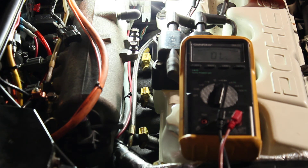I'm pretty sure Megasquirt had nothing to do with this, so I'm going to go ahead and get another injector on order once I pull the fuel rail off and find out what they are. They're either 510 or 560cc injectors off an Evo, I believe — they have that yellow top, which is the Evo color code. Basically when I was trying to start the motor earlier I was dumping basically half a liter of fuel per minute, and that's why my fuel pressure was dropping.